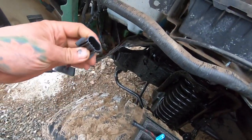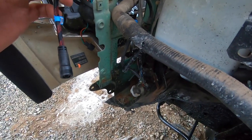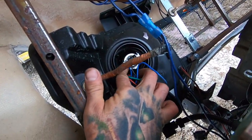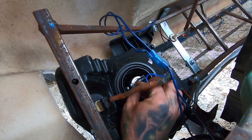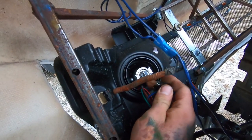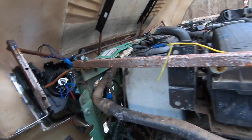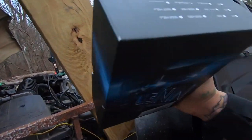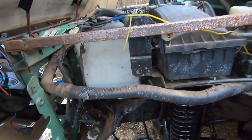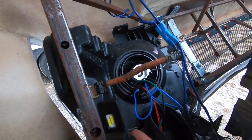These are fairly simple — it's got this ballast thing that goes in it, the hookup is right here, and the bulb goes into the stock location. This one's actually a twist-in, so we're gonna see if this actually works. Let's get this old bulb out — should be just a clip here that just slides up. These are H7s... and these are not H7s, these are H13s. So it's looking like the bulb is actually different from what the stock truck has.